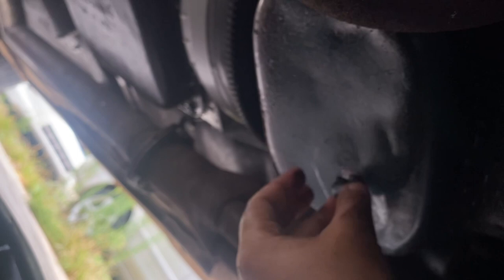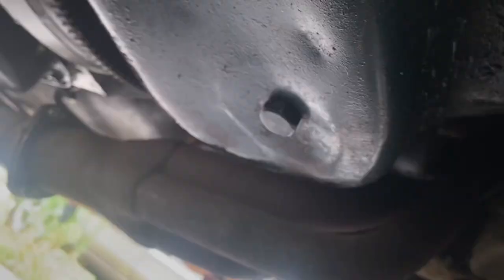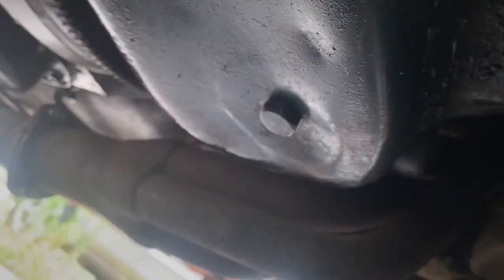We're going to clean up the drain pan a little bit and take our drain plug and throw it back in. We're just going to tighten it until it's snug — don't need to hulk out on it. Don't tighten it so tight you dent the oil pan, which it looks like someone already has. But you want to make sure it's nice and tight; you don't want to be smelling burning oil for a while.